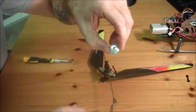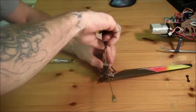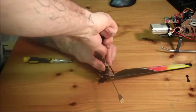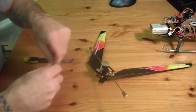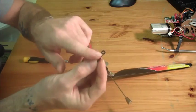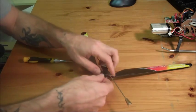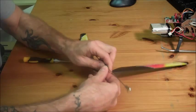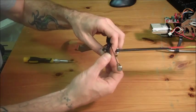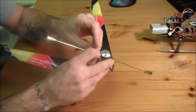Go ahead and take your top cap back on there, set it in, and go ahead and screw it back down. For the linkage that we took off earlier, go ahead and pop it right back on. Remember not to bend these little ends right here — if you bend these, go ahead and replace them so you make sure they stay locked on and don't come off while you're flying. A little bit of pressure just pops it right back on. Repeat it for the other side.